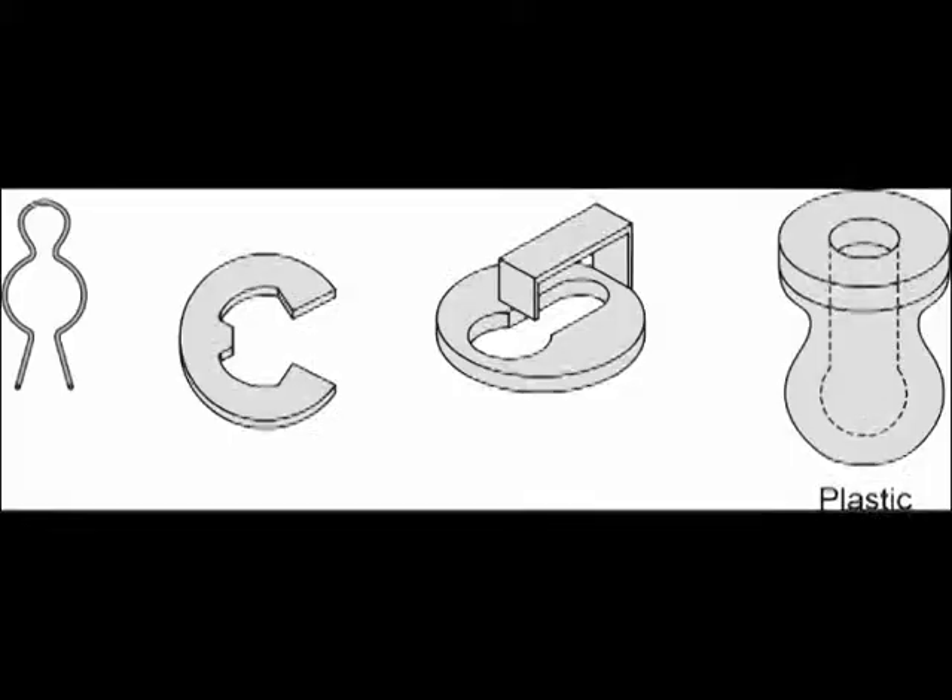I should briefly talk about clips. On the far left is a spring clip — you'll find these on equipment more than anything, maybe some throttle linkage. The e-clip is used in brakes — we see it all the time holding the parking brake lever on the rear shoe. The third one is a throttle clip used in GM vehicles for years, probably still used a little. And the plastic one on the far right is used with forward linkage, from transmission linkage to throttle linkage.